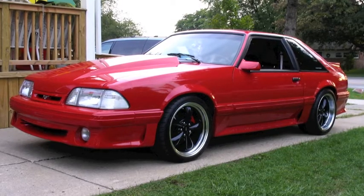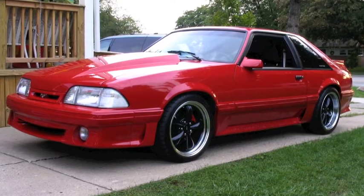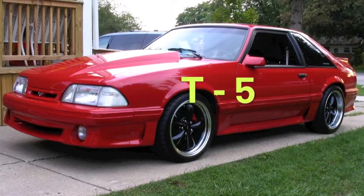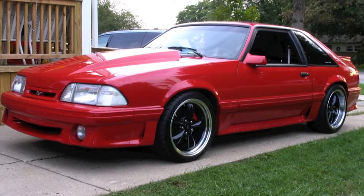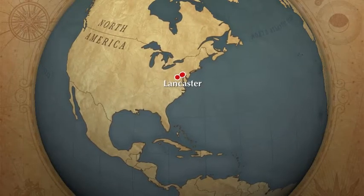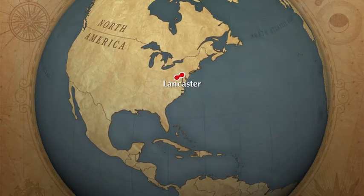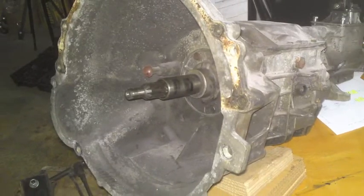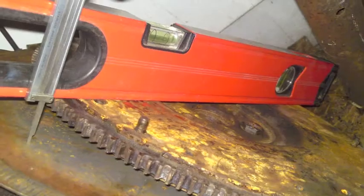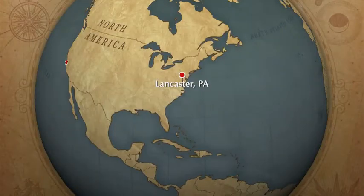And now a Ford Mustang with a 5.0L V8 engine. Through conversation with several mechanics I decided to use the transmission usually paired with this engine — the T5. From what I've learned it sounds like this would be a good match for the taxi and the Warp 11 motor. I eventually found one online at a decent price, which required my dad and I to take a short trip to West Virginia. Apparently not many people have used this transmission in conversions, so I had to actually mail the bell housing, flywheel, and some measurements to the folks in California that would be fabricating the motor adapter.